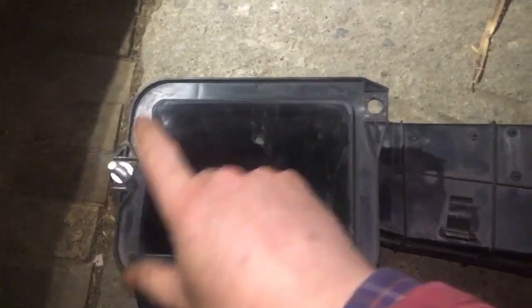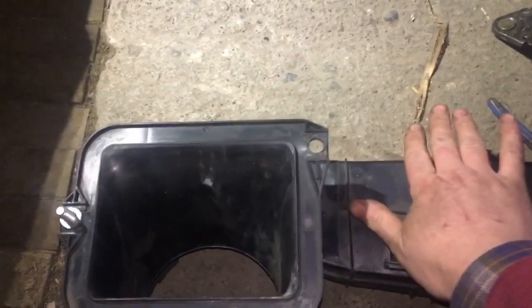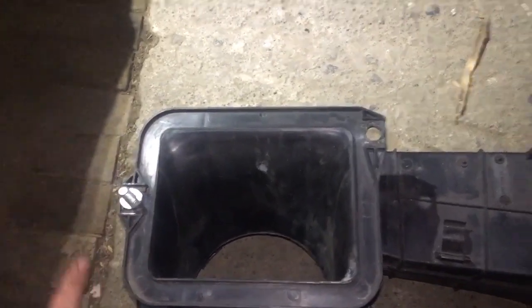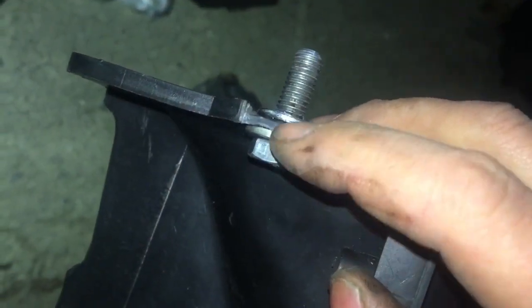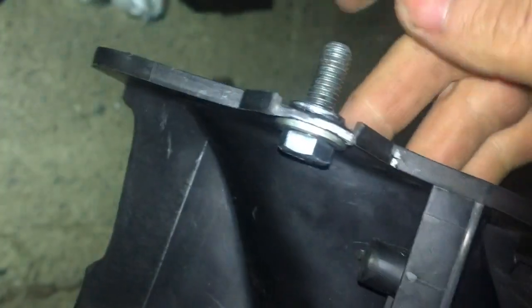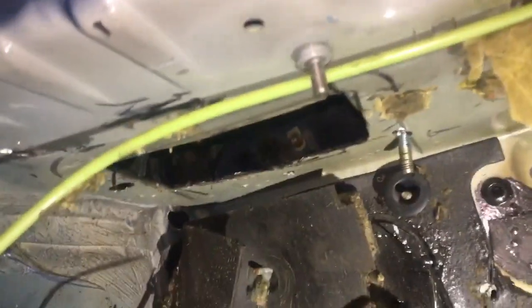Let's get the B4 Passat fan unit into the Corrado. We have to do a slight modification — it naturally bolts here and here, whereas the Corrado ones have a bolt just back here which is easy to get at. On these because there's an A-pillar here, you couldn't even get a spanner in to tighten it. So what I've done is got a washer that was too small, tapped it, used red Loctite, and it's permanently locked in there now. All I have to do is wind my nut on — easy mod, but think outside the box and you'll fix anything.